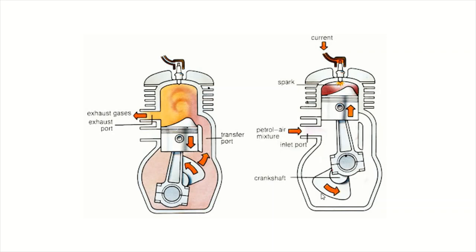As the piston comes down, your intake comes in and then comes out through the intake ports to the cylinder — those are the four holes we saw in the cylinder wall. Then it'll get compressed, have your power stroke just the same as any four-stroke engine, and come out the exhaust. One of the problems with a two-stroke engine is you have your intake and exhaust open at the same time. Some of your intake charge will leak out the exhaust — that's unburnt fuel and air, and you're losing power. On top of that, you get low compression ratios because of all this air flowing through. Two-stroke engines normally only have about a 6.5 to 7-to-1 compression ratio, versus a four-stroke which can be as high as 12 or 13 to one.